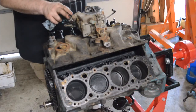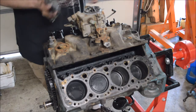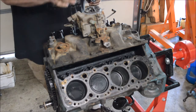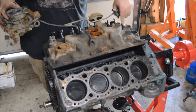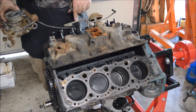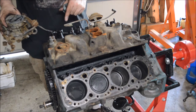I also wanted to show you the carburetor and the intake manifold as it would be bolted on. The carburetor mixes the fuel and air, which then travels through the intake manifold into the individual runners and connects to where the intake valve is. We'll see those valves being actuated in the next step.